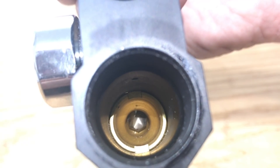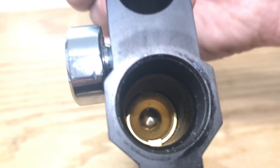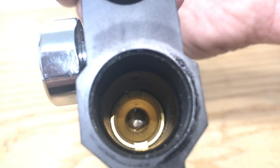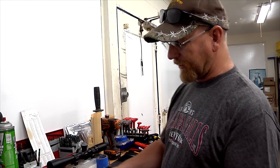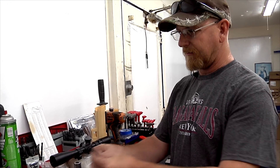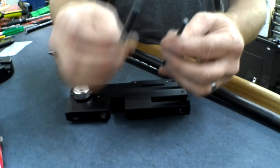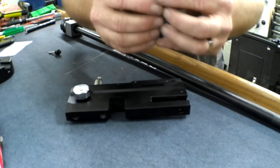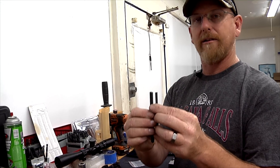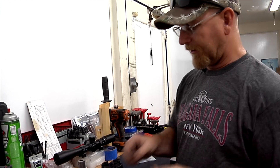On a side note, if you look at the depth of that drill bit, you want to make sure that you don't go any deeper than that. If you do, it could damage the bottom of the valve. We've drilled out our valve — just a size comparison. Here's the size difference between what it was and what it is now. This is actually an M size, not an N, but it's only about seven thousandths difference. Pretty big difference in port size and airflow.